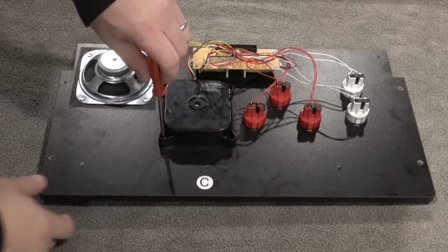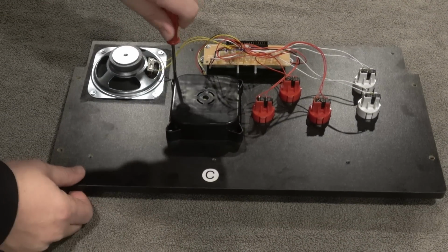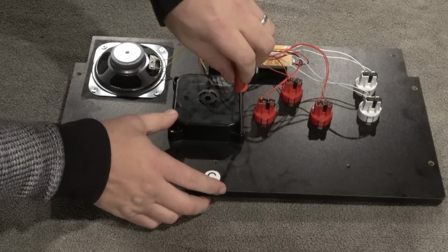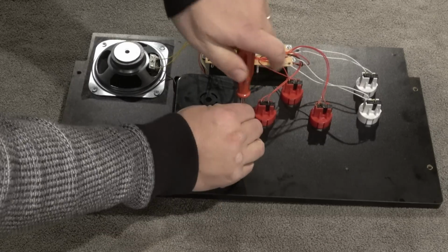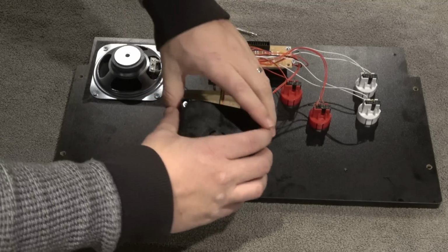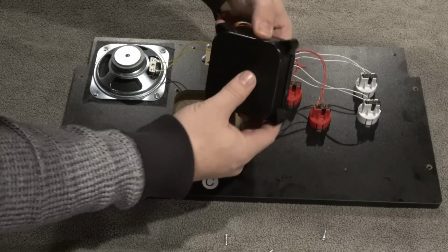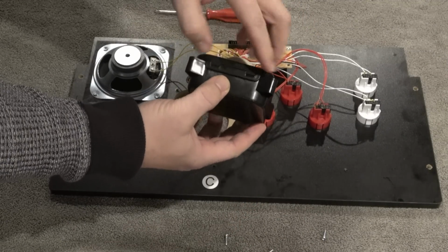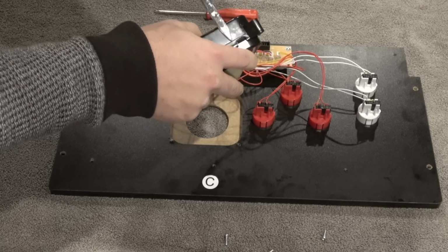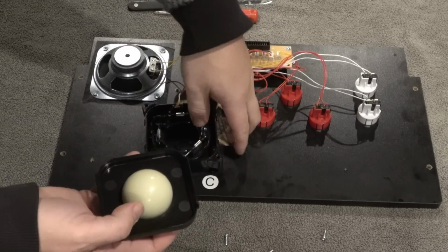Alright, next part, using the control panel, we're just going to simply unscrew 4 screws using the same screwdriver that fit with the control panel. I really do like that this is easy to mod and fix things. Even though mine didn't come to me working as it should have, I am thankful for that. Alright, you just have 4 screws pop out like that. And what I'm going to show you, with these 2 clips on each side, is an easy way to pop it off. I use a letter opener or something flat. Okay, and you pop that, and there's a trackball. Just put that aside.